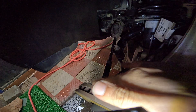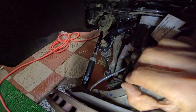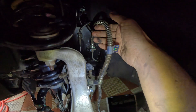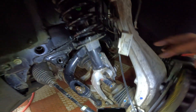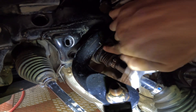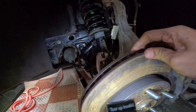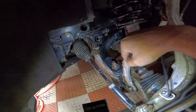This is the heat shield — braking systems can get pretty hot, so the heat shield avoids transfer of heat to components like the rubber boots. This is the brake line coming from the master cylinder going into the braking system. Since this is a four-wheel drive version, we have the drive shaft for the front wheel coming from the secondary differential and going into the wheel housing. This is the wheel nut, this is the brake disc, and these are the drive shaft boots — one here and one here.